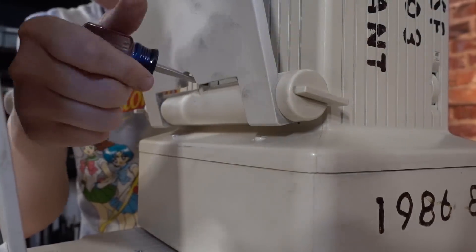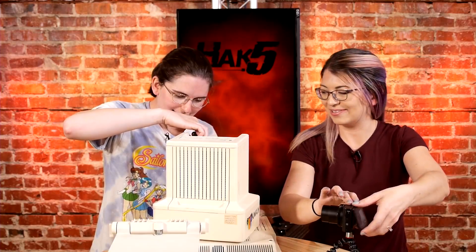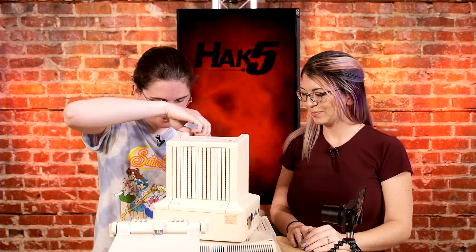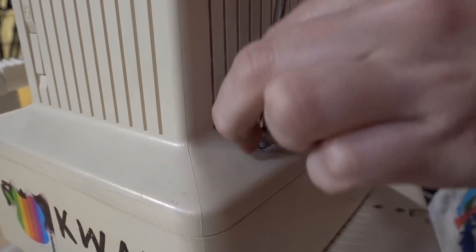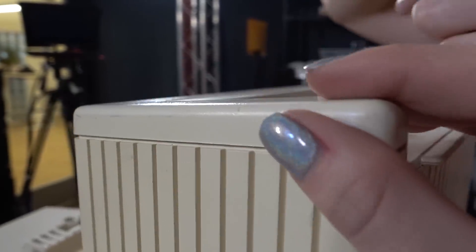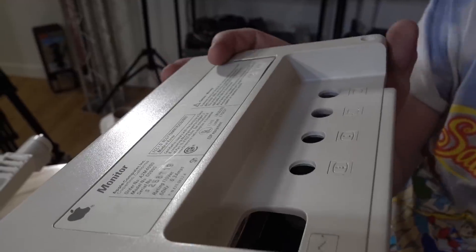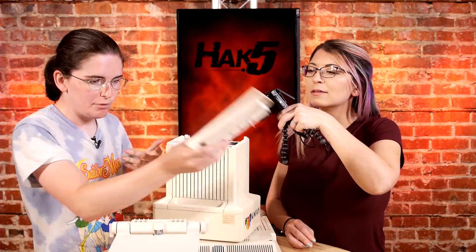Can't get it to work — let's look inside. So the tubes act as a big capacitor and they hold about 20,000 volts. The secret to shorting out a tube is a little jumper to a screwdriver — hopefully a flathead — and then underneath there is a little rubber thing you stick underneath there. You plug that into the ground and you can short it out. This reminds me of a little old IBM one I found at the recycling center — it was a six-inch black-and-white IBM monitor. It looked like one from a PS2 computer but it was just tiny and cute. Unfortunately it got broken on shipping.